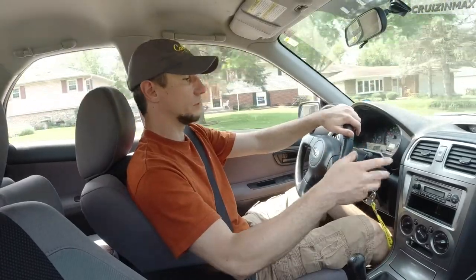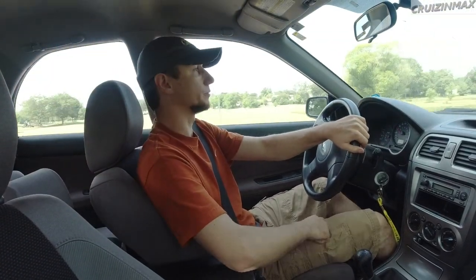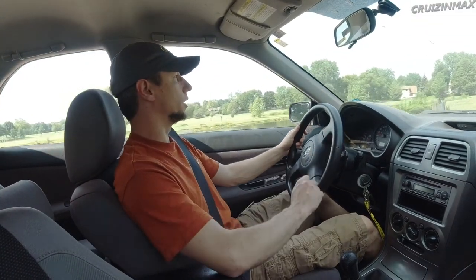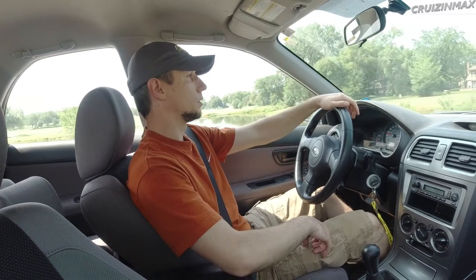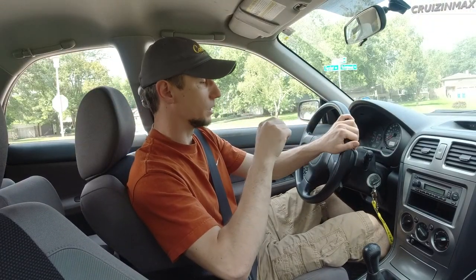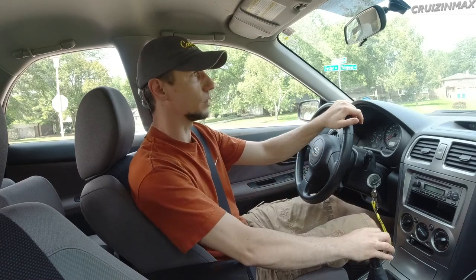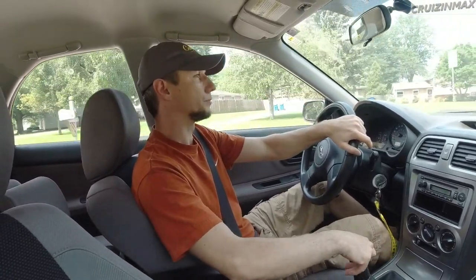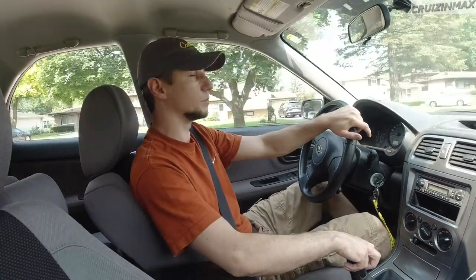Let's drive this thing. As I'm driving it's pretty normal — by no means quick, it's slow actually, brakes kind of suck but it's been sitting for a while so the car needs to be driven. No check engine light, no idiot lights at all. But what I've noticed once it's warm — I'm going to pull over, listen to the engine and the exhaust. That initial rev from like 500 to about 1500 RPM — that's too slow. There's something going on, it's bogging down.